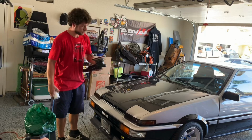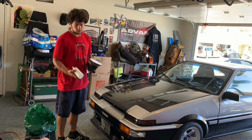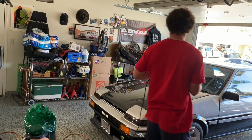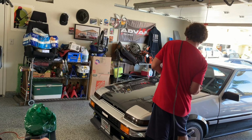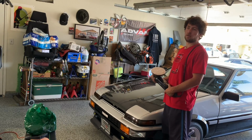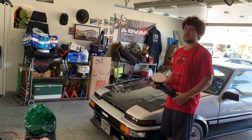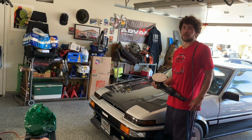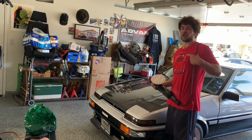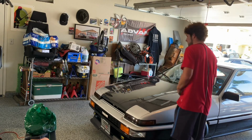So I am gonna do about a, just under a dime size drop of product on this polisher, but I'm only gonna cut on speed 4 because I don't wanna get too aggressive. So usually you wanna work in a 2x2 section. Any video you watch, you're gonna see the detailer moving super slowly and telling you to do this, but in reality, most of us, unless we're being watched or are on video or under the gun, are actually moving a little bit quicker and doing a lot larger sections than is recommended.